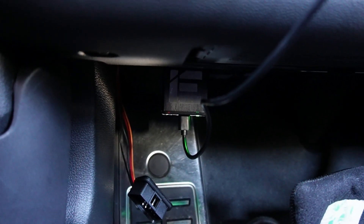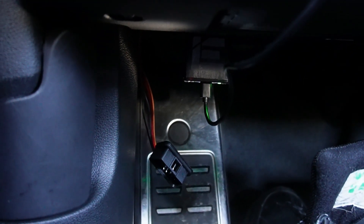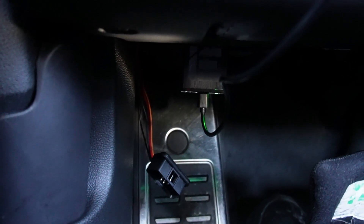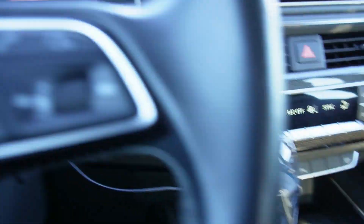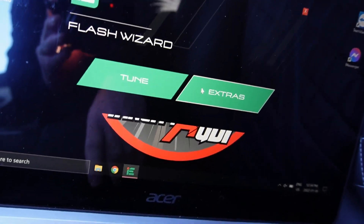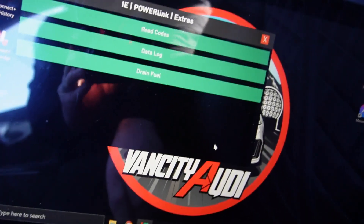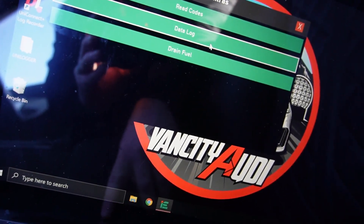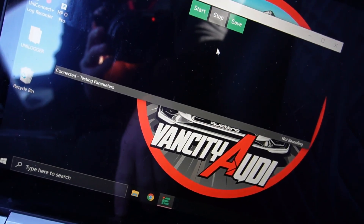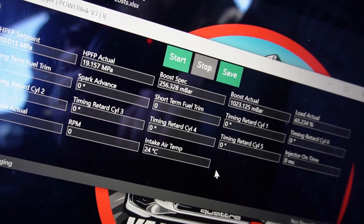The first thing you have to do is plug the dongle into the OBD2 port. What you see hanging out of there is my P3 gauge connection — I had to remove it in order to plug in the cable. Make sure you have power to the car. The engine does not need to be running to make the initial connection, but obviously the car has to be running to log. Next, go into Extras, then Data Log will pop up. Click on Data Log, it'll load up and make the connection, and you are done — it's amazingly quick with this system.